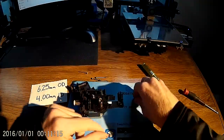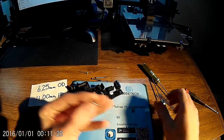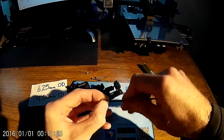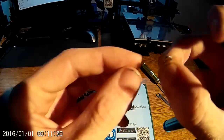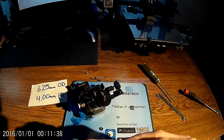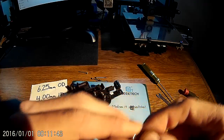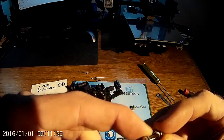and this, and the washers, and what you do is take the nut off with your 2.5mm, set the nut down, take your washers. I use lock washers that have the split in them, bent off each other, and I just crush these flat with a pair of pliers real quick. These measure exactly 1mm in thickness, so 2 of these would be essentially taking up 2mm of space between the back of the bolt head and the nut face.